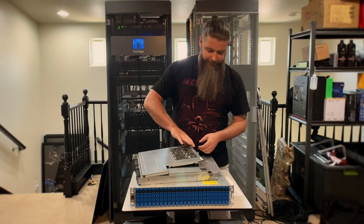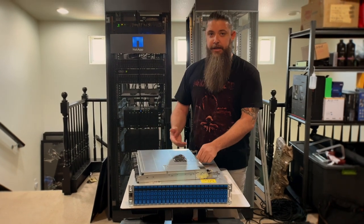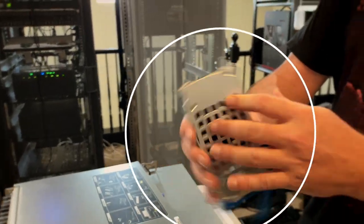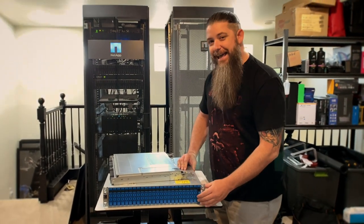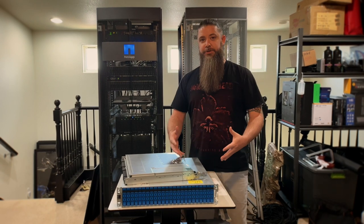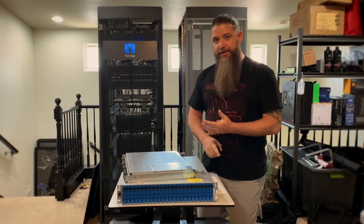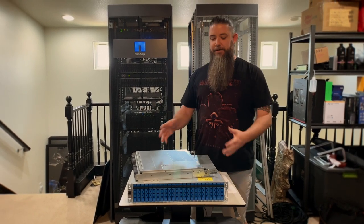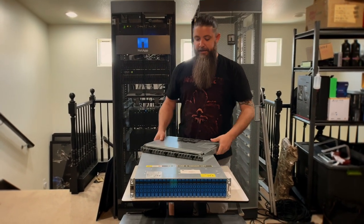In addition, another big part of this is that you can expand it. As you saw, we have 15 terabyte drives in this one — they come in caddies, they're NVMe connected. One of the biggest things about this system is we now have an end-to-end NVMe system in the 2U embedded space — embedded drives, no additional shelves. You're talking hundreds of terabytes in a 2U footprint with the larger drives. Having everything NVMe gives you the ability to do thousands of parallel processes, data writes, all kinds of IO right here in the box.